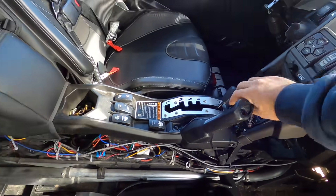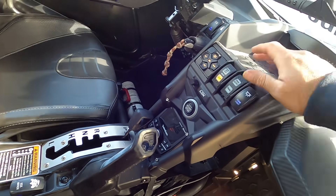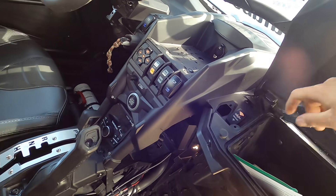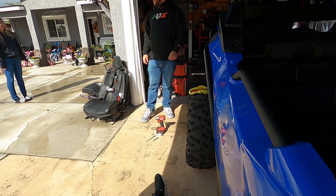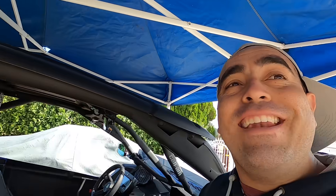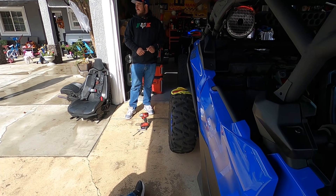We just finished up all the wiring and zip-tied everything. When you want to do this on a cold start: stick your key in, press it once to wake up, the valve should be off, then turn the valve on, then turn the car on. Then turn it off because it gets annoying at idle.